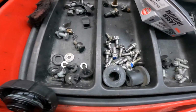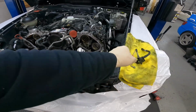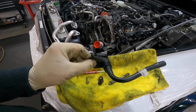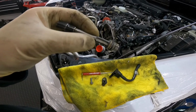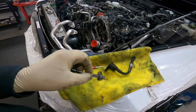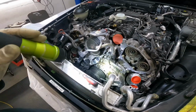This is the timing cover bolt. Steel, aluminum, and of course they stretch and then start leaking. Here is the problem. Another problem, all plastic pipe is broken. When we start to remove, see this one sitting deep inside. I used it to remove the top. I just make the thread and push because it's overheated, and that plastic coming from Mercedes, from BMW, exactly the same. And you just touch and boom, like sugar.